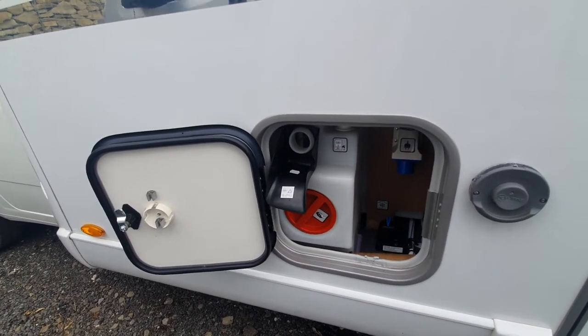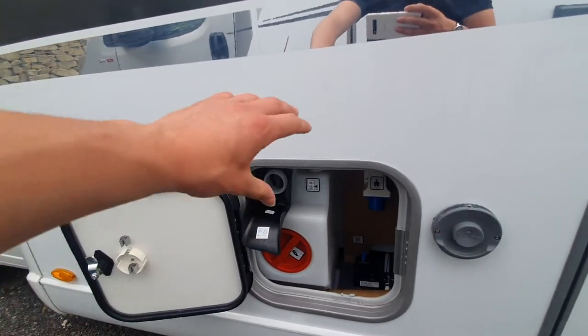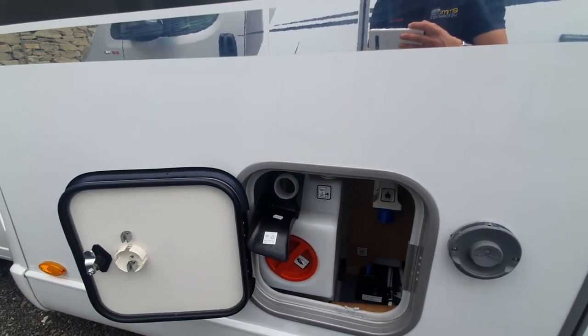If you're wanting to drain down the whole system — the whole 120 litres — all you've got to do is keep turning past that lug until you can no longer turn the valve, and that'll empty the whole system.